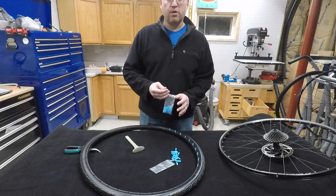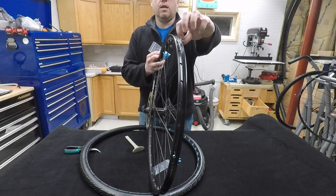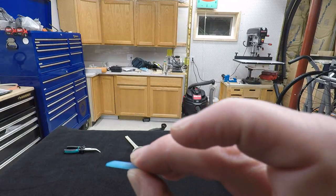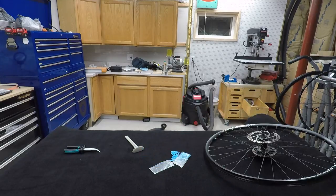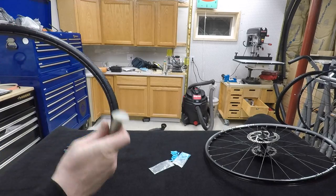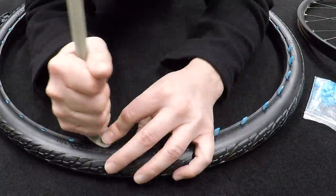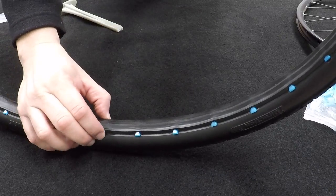I had a little bit of a delay — I wasn't able to use the pins that came with the original kit, so I had to have Tannis send me some wider pins. The problem was that the rim has a little more of a lip than I expected, so the original pins weren't going to fit. Now that I have these it's just a matter of putting them all in the tire. See how the pin has a chamfer on each side — the chamfer side goes down into the wheel. You start putting them in the tire like this, then use the included tool to push it down. Once you get those in, make sure they're centered with the bead, so push those in a little bit more.